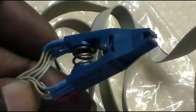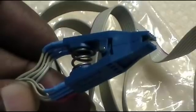Here are the tools and equipment we're going to be using. This is a clip that we'll attach to the chip inside the immobilizer. This is the device we'll use to read the actual PIN code — we connect that clip to this device, and then use some software to pull the information out.